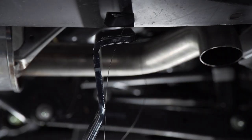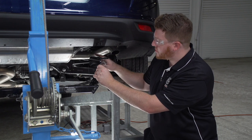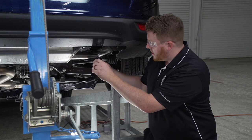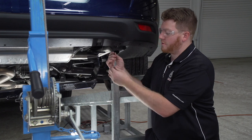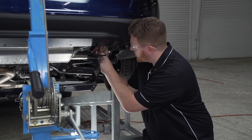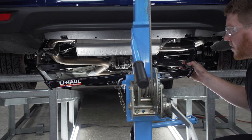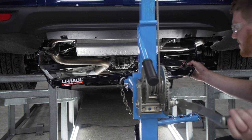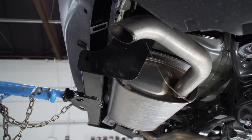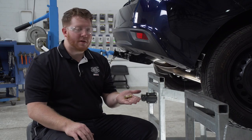For our most forward hole, we also have a spacer block that's going to be sandwiched in between our hitch and our frame, so we're going to run that fish wire through the spacer block, then run the fish wire through the most forward hole on our hitch. We'll do that on both sides, then bring the hitch all the way up over our exhaust.